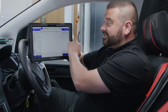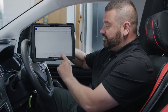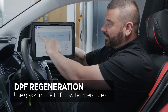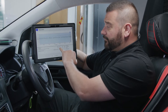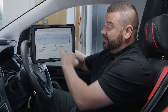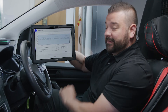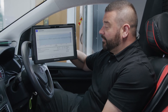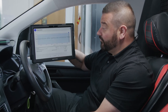We're getting part way through now — the soot content is dropping and the temperature is up at nearly 470 degrees. We can switch to maximize mode and then graph mode so we can see the temperature steadily climbing, currently at 494 degrees. This is the temperature sensor after the DPF. We're probably getting close to the perfect temperature where we're going to start burning that soot. Any ash left will sit in the filter, but by doing this we're going to unblock and allow a freer exhaust flow through the DPF.